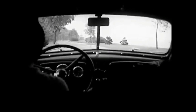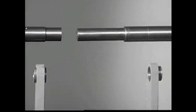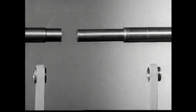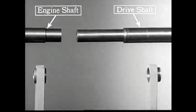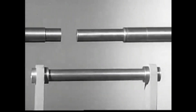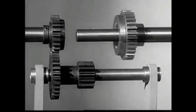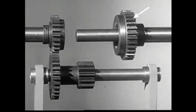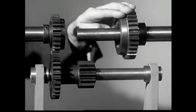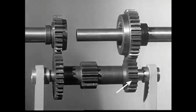The transmission is located right at the bottom of the gear shift lever. Let's put together a model of the gears we shift in our motor car. The shaft on the left comes from the engine; the shaft on the right carries the power back to the rear wheels. To connect these two with gears we'll need another shaft known as a counter shaft. Two gears carry the power from the engine shaft to the counter shaft and are always in mesh. The gear on the drive shaft going to the wheels is free to turn around the shaft — we'll put it in mesh with another gear on the counter shaft, and these gears are always in mesh.